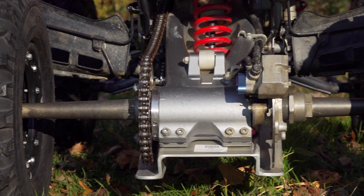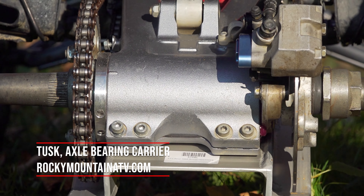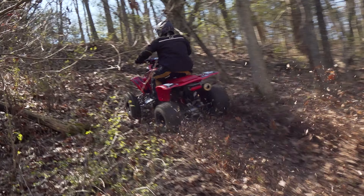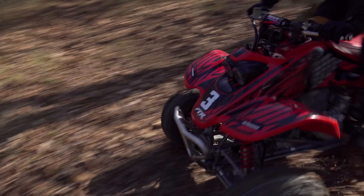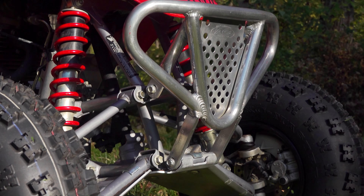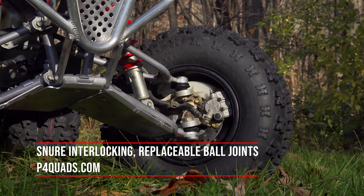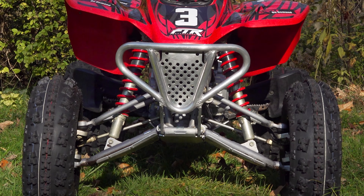Tightening up the chassis, we destroyed the stock bearing carrier trying to remove the stock bearings without a press. We replaced it with a Tusk axle bearing carrier from Rocky Mountain ATV. Test rider Evan Hartzell has used a Tusk carrier in his personal race machine for an entire season, so it's already proven to be an acceptable, long-lasting, and affordable replacement. The play in the stock front ball joints was minimal enough that we left them alone for now. Sure Interlocking makes a replacement front ball joint kit that requires you to cut out the stock ball joints and weld in new ones; after installation, the ball joints can be removed and replaced in the future with no cutting or welding required. Sure Interlocking's ball joint kit is far more affordable than purchasing new aftermarket A-arms.